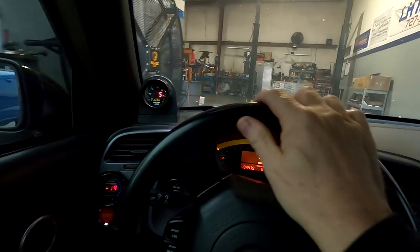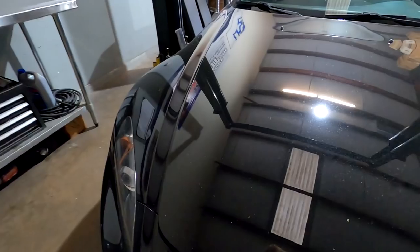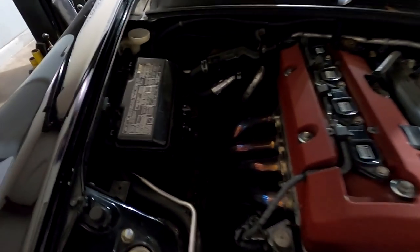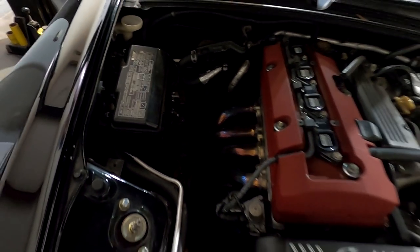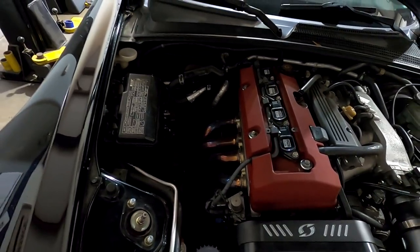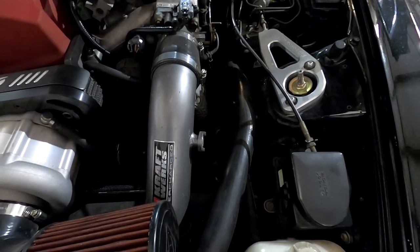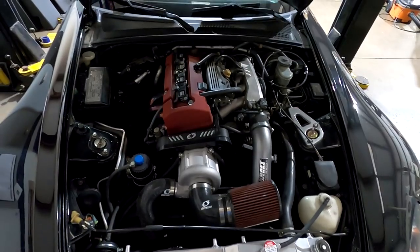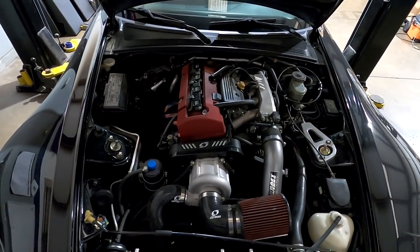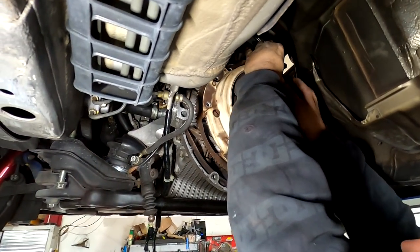It's going to be interesting to see this one come out. I'd like to find a heat shield — the battery would usually go here but there's a heat shield between the header and the fuse box that's missing. You can see how early of a kit this is because we don't orientate the filter that way. We'll be changing that pipe to lose that intake temp sensor adapter. It's always good to see a kit being enjoyed for this length of time — that's what a seven-year-old Clutch Masters clutch looks like.